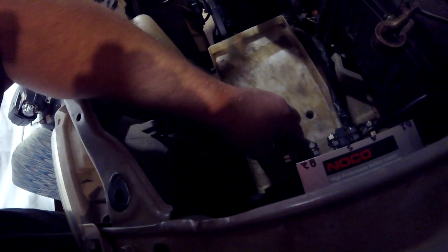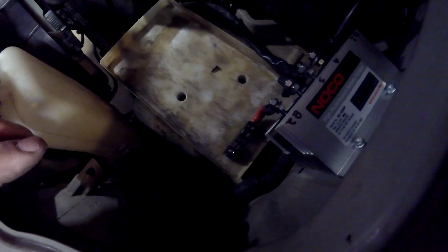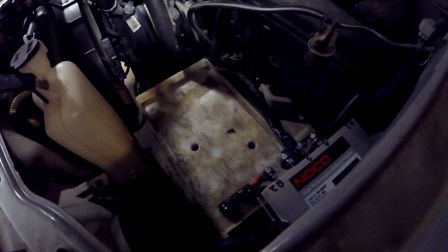Okay, so I'm going to mount this fuse here because the battery end's right about where my finger's at. And it's going to be inboard of it. But if anything pulls, or if this little set screw or anything comes apart, or if that cable comes out of that end, where's it going to go? It's just going to lay on that plastic. It's not going to cause a problem. And then when we see our battery in the house draining down and not recovering, we'll know something's wrong with the system and we'll figure it out. It'll be just like a blown fuse.